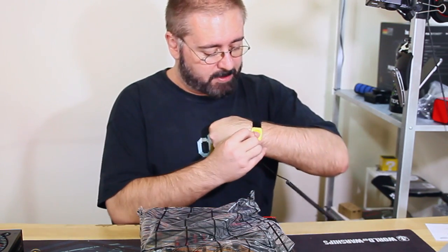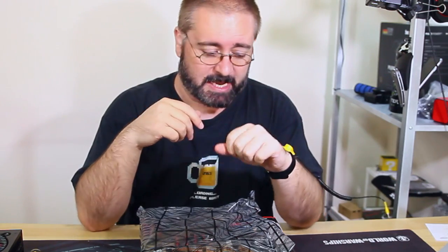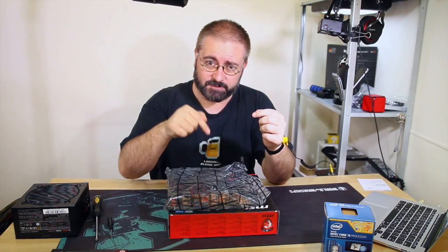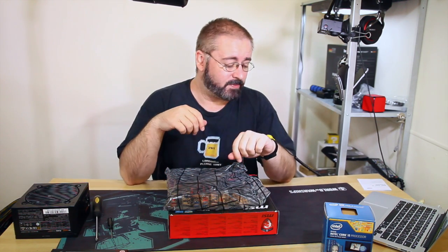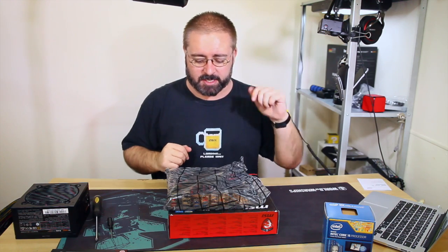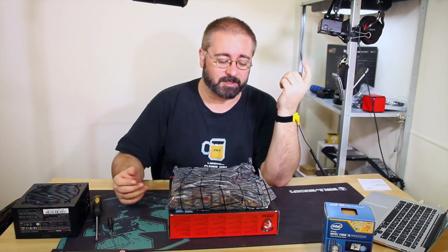I'll attach myself to my anti-static wrist strap. Not incredibly vital - there are other ways to ground yourself, like plugging in the power supply and touching the metal case. But even if you don't feel static electricity zaps, you're still carrying static electricity a lot of the time. That low-level static you can't even feel can severely damage electronic equipment. For the $12 this cost me, it could potentially save me hundreds of dollars in blown components.